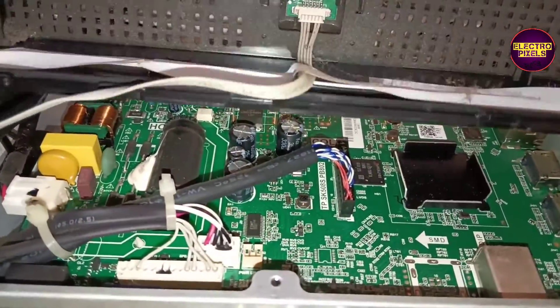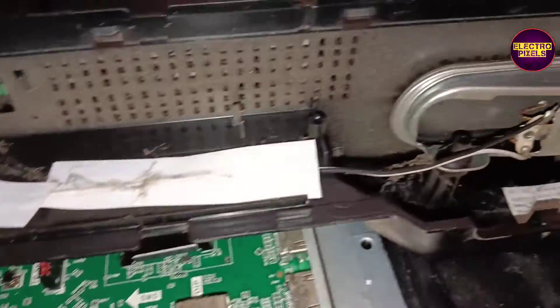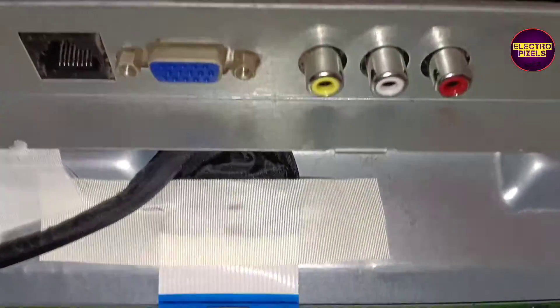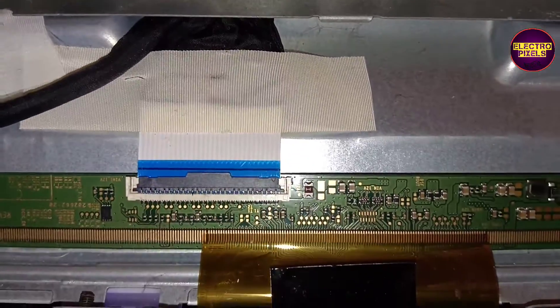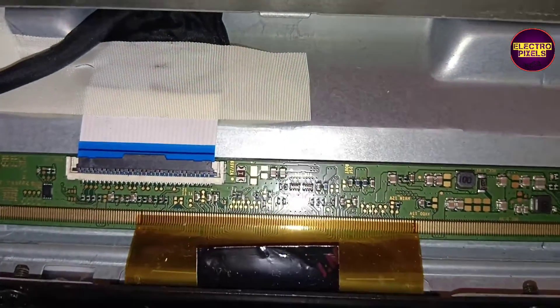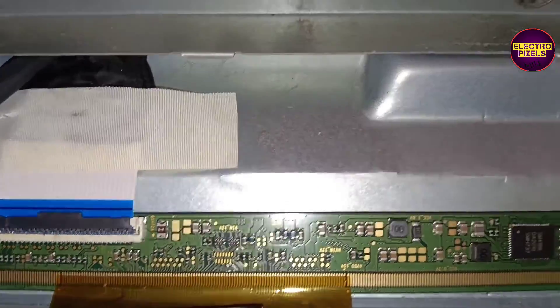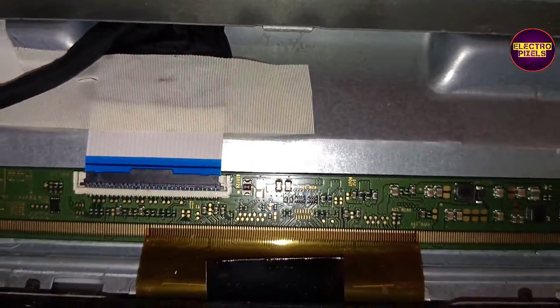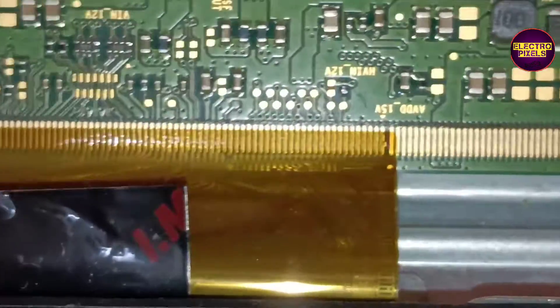This is a smart TV. It comes with a 32-inch HD-ready Samsung panel with an SM4186 DC-to-DC IC. As discussed earlier, due to internal shorting in the gate signals inside the glass panel, the panel DC-to-DC IC goes into protection mode.